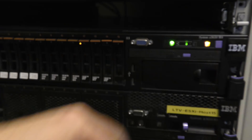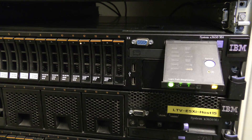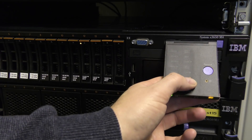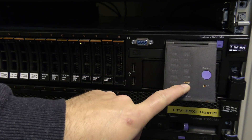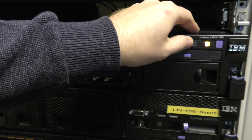I just happen to have a disc that we can replace it with. Let's go a little bit closer and see what we have here. The server is blinking and operating, and it has a display up here that we can pull out — it tells us there's a hard drive error. It clearly says that this is the hard drive that has failed. Be careful not to shut off the server while pushing the display back in.